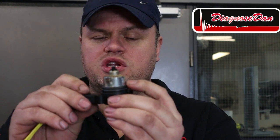I just reviewed a part of the video of me trying to free up this solenoid. Now I noticed that in the video you could hear two kinds of clicks. A hard click, which I could also pick up with the naked ear, and a softer click when I couldn't hear anything at all, but only the microphone picked up. Now the hard click was the solenoid moving all the way, like it is supposed to. When you hear the soft click, it's the solenoid being stuck and trying to move, but it can't. I also noticed that sometimes you can hear a delay in the spring pushing back the solenoid. All more proof that this solenoid was our problem.